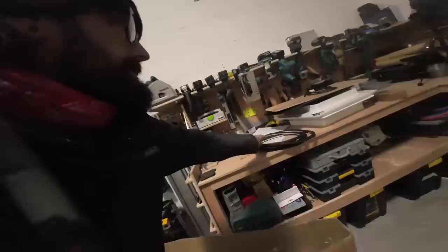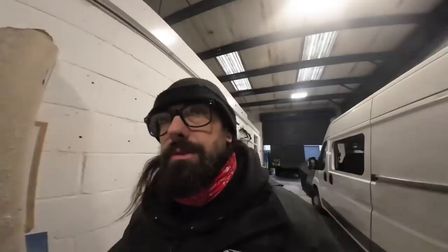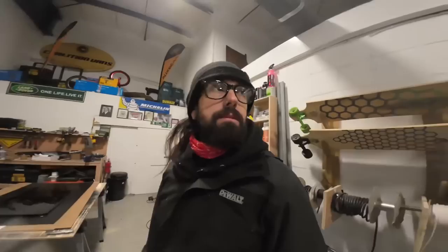There we have the hole — I've painted around the edge on the bare metal to stop it from rusting. Next, just to put the trim on. It's basically like a U-shaped trim, and that just knocks on — just use a rubber mallet or something to knock it on. Make sure the join is at the bottom so no rain can get in. Top tip: put the sealant in some warm water — it softens it up a little bit so it's easy to get out of the mastic gun. You should always do that because it is quite solid, especially when it's cold. Soak it in some warm water, get it warm — or I could put it in front of my diesel heater for a bit, warm it up a tad. Then it's going to be ready for primer on.